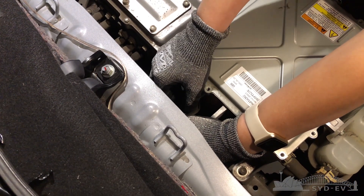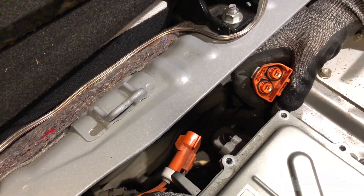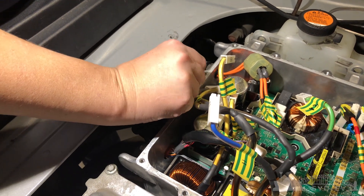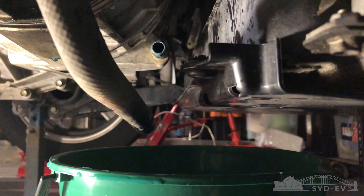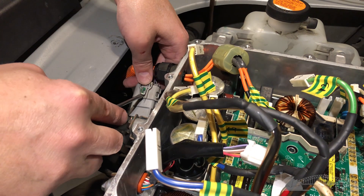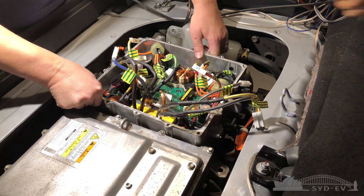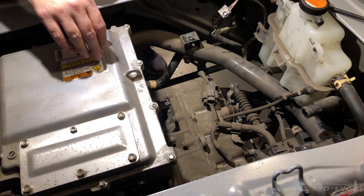Removing the converter is actually not too hard. There's one mounting bracket at the front to undo, plus a plug at the front and an earth lead at the rear near the bumper bar. The hardest part is removing two coolant lines from underneath — you've got to get under the car and pull the hoses out. Once all the coolant is drained and spilled all over the floor, remove the coolant bottle from the left-hand side of the converter, then unplug the AC inlet plug. Then comes time to remove the converter itself — this is where you might also rip out any wires or things you forgot to disconnect.